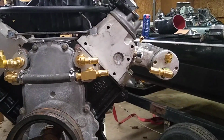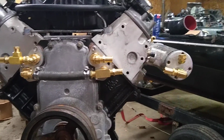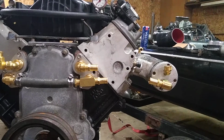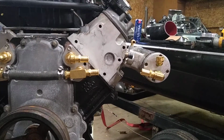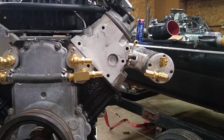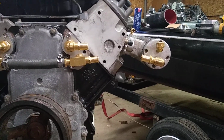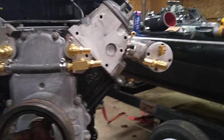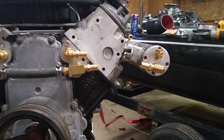And as soon as you plug the pump even a little bit, the efficiency of the pump goes away, and then you don't have any pressure on the tail end of the impeller inside the bowl, and it's the pressure in the bowl that forces the water up the cooling line. So you lose cooling water, and if you're not paying attention, the boat overheats. And with the amount of shit that I'm probably going to run this pump through, there's going to be a lot of sediment going through this thing, and that's a different issue altogether. But it's going to be losing its cooling water probably pretty frequently.